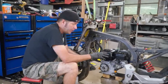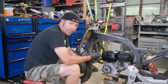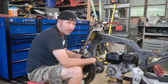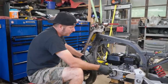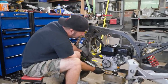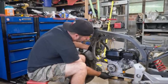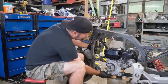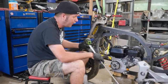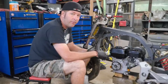I think we've got it figured out pretty good. We are going to trim off these ears on both sides, which will allow us to bring the engine a little bit forward. And we're going to cut some pipe — a lot like this pipe right here — and we are going to go underneath the engine plate and pie cut it at the front since it's got such a sharp angle up. This is about what we're going to have, either one or two pipes coming up. That should secure the plate pretty good, and then we'll be moving on to a jack shaft.